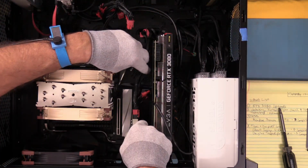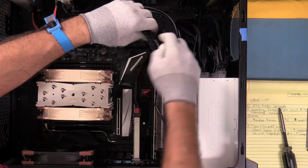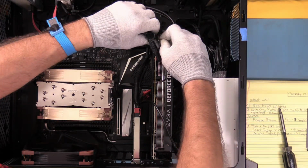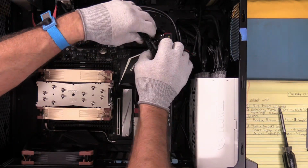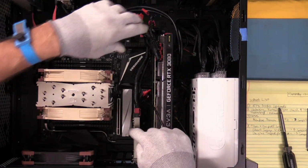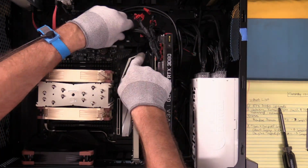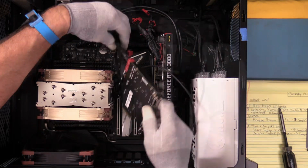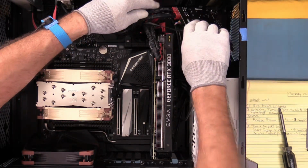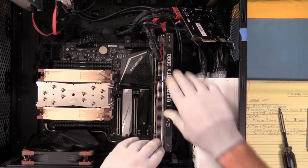Okay, we'll bring in Thunderbolt 3, get our power back up. Because we're in a different slot, I expect Windows to have to go through the enumeration process, because the BIOS is going to re-enumerate the video card, re-recognize. And since it's going to recognize in a different slot, I'm not sure how that would affect Thunderbolt. So what I want to do is get my cables lined up so that they're all out of the way. I'm going to leave this card out until we get video up and running. But if you'll notice, they're crossed over. So I'm just going to set it aside. Nothing touching, nothing connected. So video's in. I've got one screw holding the video card down. It's secure. So what we need to do now is power up, see what we got.